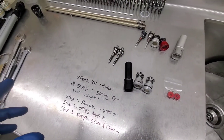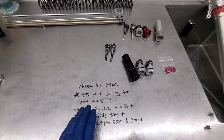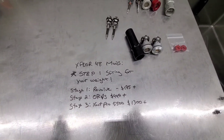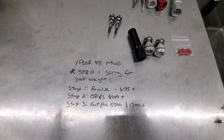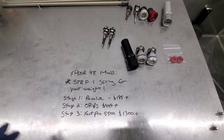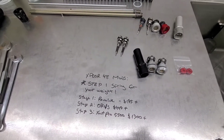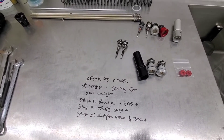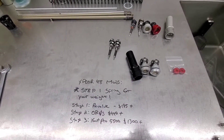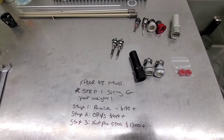Step one, before anything else, you need to get a baseline — spring it for your weight. These bikes are topped out at 187 pounds with gear, so don't guess. Put all your gear on, or grab it in your arms, then step on the bathroom scale and figure out how much you weigh with gear. That is paramount. Everyone carries different amounts — usually the average is about 25 pounds for an off-road rider. Spring it for your weight, get the sag set, take it for a ride. Your average guy doing average trail riding isn't going to have too much of a problem with it.